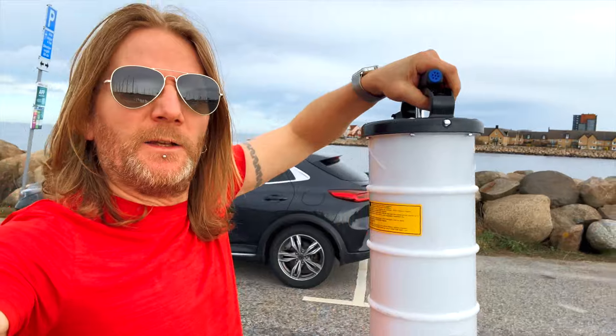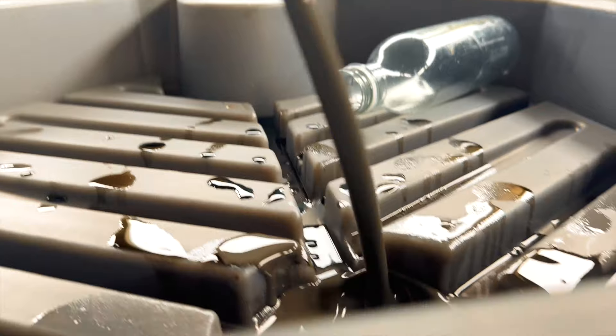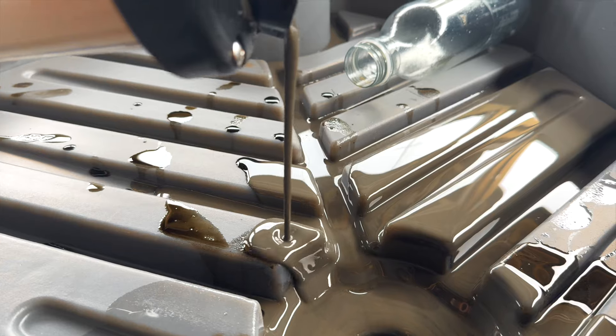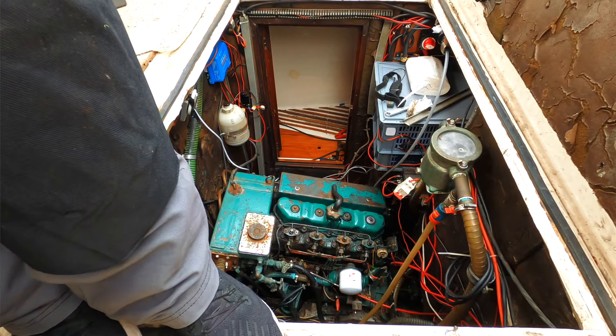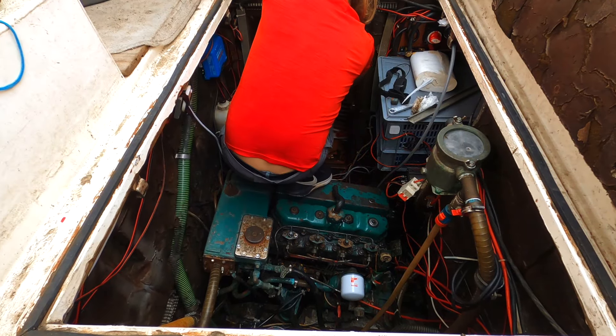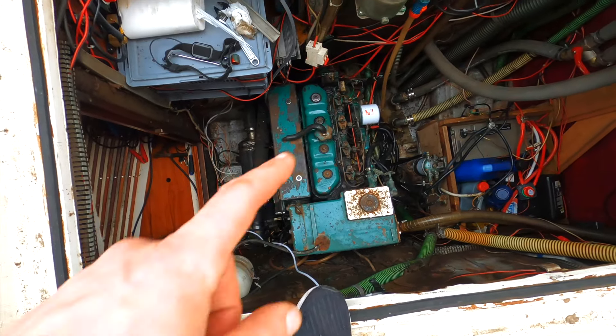The sun went away and it started to rain a little bit. There is no wind, so I can't test the wind generator. But it is still pretty warm — I have a t-shirt on. Now I am emptying the oil, number two of three. Hopefully this next one is going to be the last one. The colour of that oil doesn't exactly scream 'you're done with the service,' but I was still in denial and hoped the water came from the old oil within the system. Time for the third oil change, which should hopefully be the last. This time I will also change the oil filter.